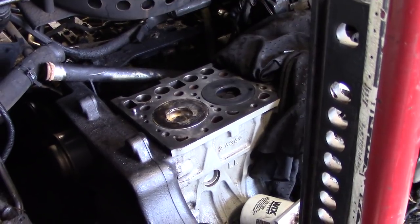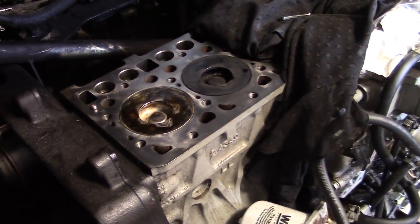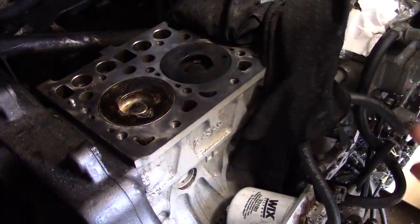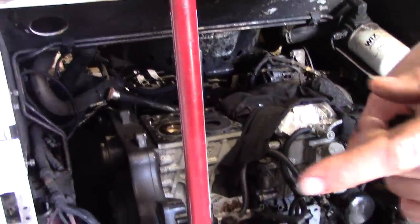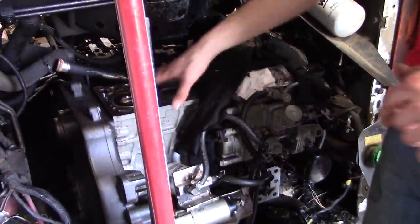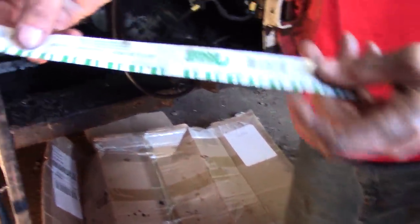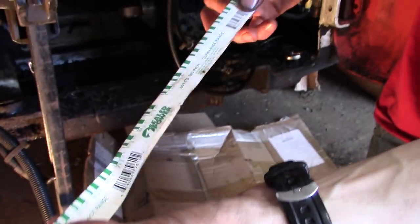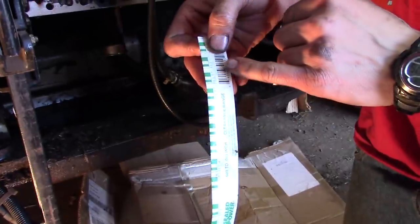Now that that's in, I've got the crank set at the bottom. I'm going to shove this down and align it with the crank journal. I'm going to put PlastiGauge on the cap — I'll show you guys how I do that once I get everything set back up. So this is PlastiGauge — this is sealed power brand, the green stuff. It's for measuring the oil clearance on your crankshaft journals.